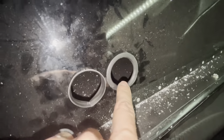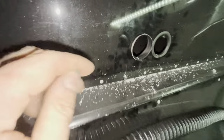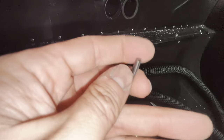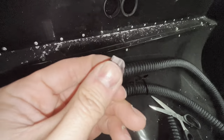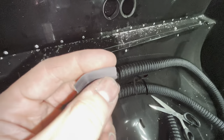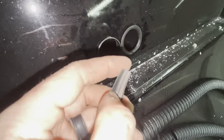On these pieces, this is where it's going to pass through the back seat. I've already done this one — you can see it's nice and flush, just like up front. When you first put it in, I just want to show you — I kind of fold it open flat like that. That's what it starts like. Then you fold it open, peel off the coating on the outside, peel off the red plastic for your double-sided tape, and then stick it in there.